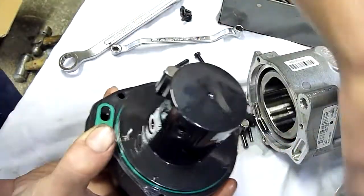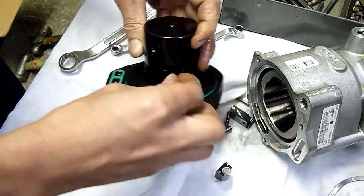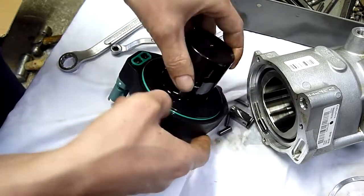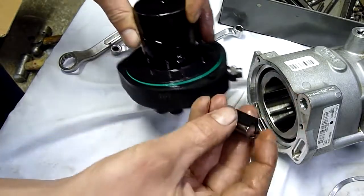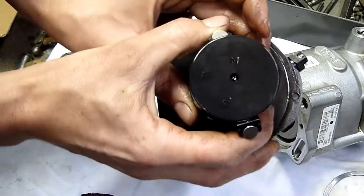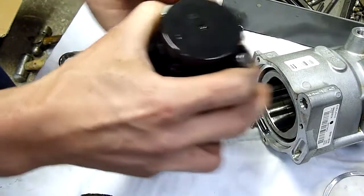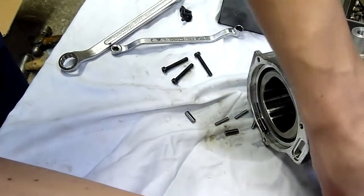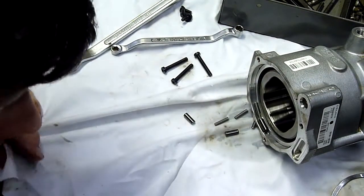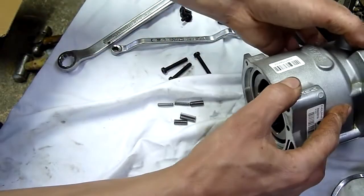There's a wave washer. I have no idea where those little ones came out of — the little ones probably go down inside here. The springs have gone AWOL as well. There are two high ones and two low ones, and that goes down to the output side — I'm guessing there are valves inside this body. It's one of the most alien-looking pumps I've ever seen. I'll need to really sit down and examine this pump to work out where that metallic debris was coming from, but I can see flecks of it coming out onto the tablecloth here.